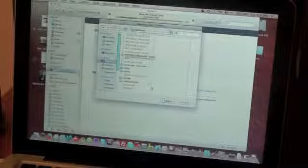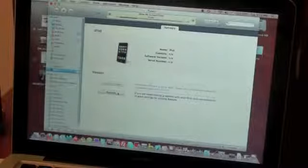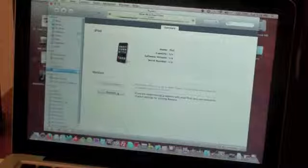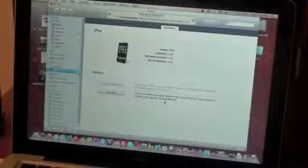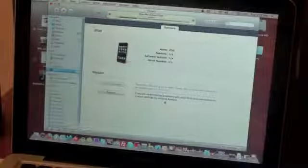If you don't want to do it this way, and you just want to update to the newest firmware, you can just hit the restore button and it'll download the firmware for you. If you do want to download your own firmware and restore to that firmware, as I said, you hold the option or shift key, save it to your desktop and select the firmware. What you can do is go to the website. I'll have it in the description below, and you can download the firmware for your device, whatever firmware you want there.